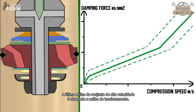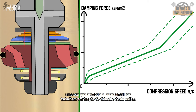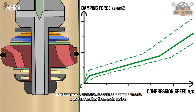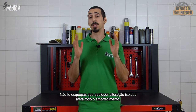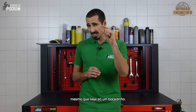The smallest shim on the high-speed shim stack is called the clamping shim. Its diameter is the most important one, because the whole valve and shim stacks work according to this shim's diameter. If we increase the diameter of the clamping shim, we are stiffening everything up. If we reduce its diameter, the suspensions will provide less damping throughout the whole suspension travel. A good rule of thumb is that the crossover shim should never have a diameter smaller than the clamping shim. Please keep in mind that any small and isolated modification will have an effect on the whole damping curve, even if it's just a tiny bit.